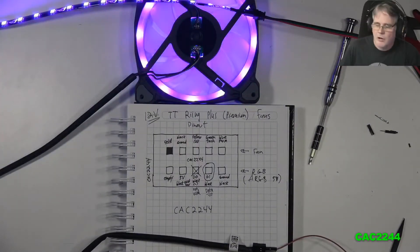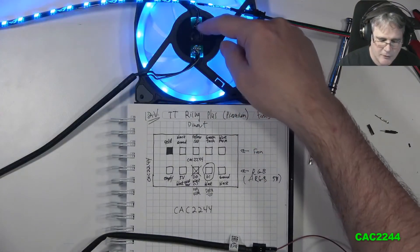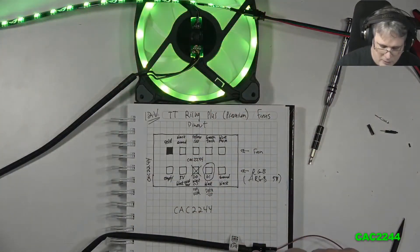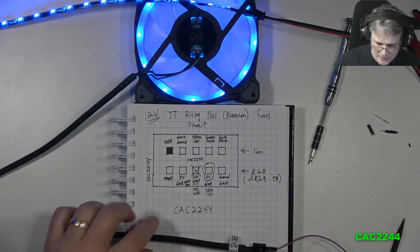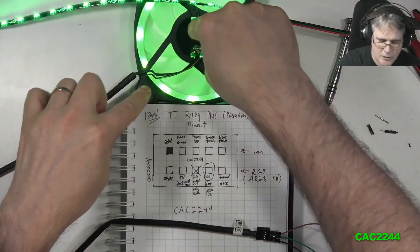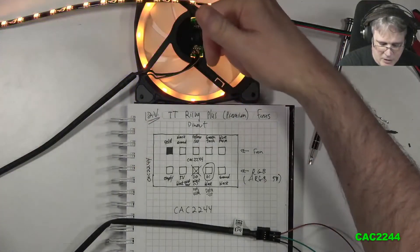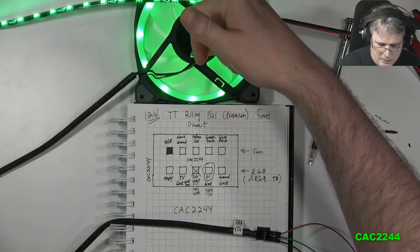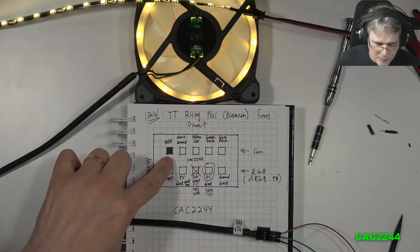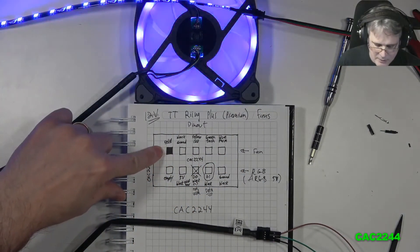As you can see there are two sections on the fan itself. I'll zoom in a bit to explain. The ARGB 5-volt section comes in from one side and connects through to the small PCB inside the fan — everything is happening in that first section. Now let me explain what it is on the header itself. The pinout for the first part — the top row where you have the solid blocked pin — this is the fan control area.